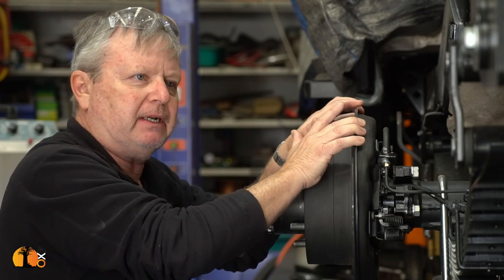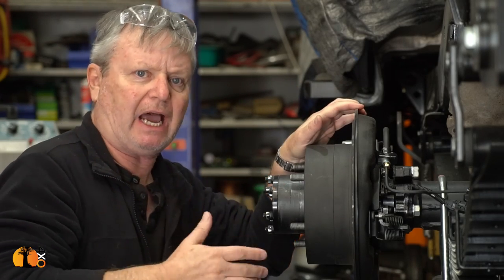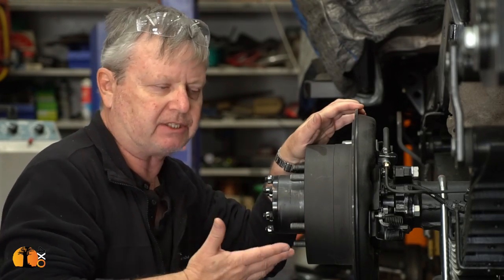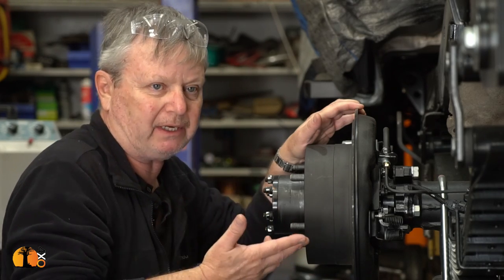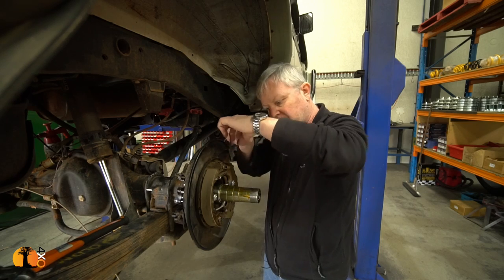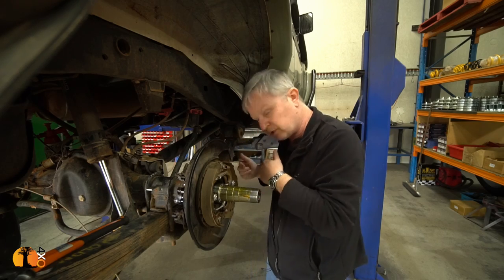But let's take away the legal issue — what about your own personal safety? Is this modification absolutely necessary with the 70 series Land Cruiser? It's not as if Toyota is producing an unsafe vehicle; it has passed relevant safety tests. So again, it's a question of: if I change it, do I need to? And is it worth doing it properly? Because properly costs more. Another consideration: the TrueTrack actually moves everything out. If you just move the wheel out with spacers or an offset, the disc rotor and drum brake are exposed to rocks and damage. They're not protected inside the wheel rim.